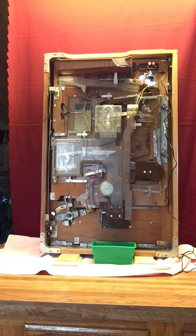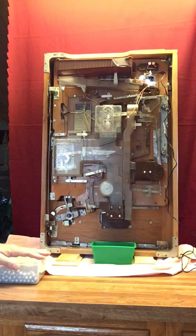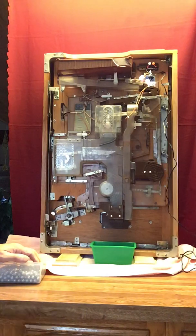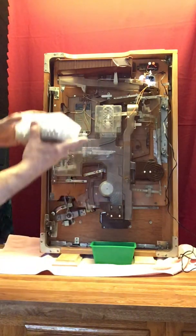I recommend 300 to 500 pachinko balls. I also recommend that you get brand new pachinko balls and not use the ones that may have been in your machine. They tend to get rusty and certainly have hand oil and smoke residue on them. That's all stuff that's not good for the machine. Restored machines have been completely cleaned, and that's the way you want to keep them. So make sure you get some nice new pachinko balls.